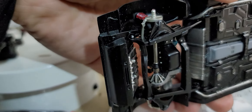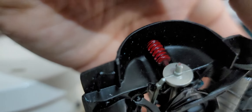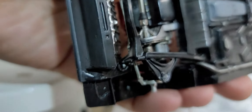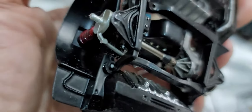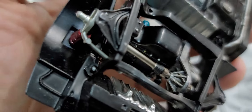When you're lining everything up and trying to install the subframe, you're going to need to move the peg that goes into the strut tower — you can see it coming out here. You're going to need to line up the subframe and the strut tower at the same time. You'll need a little bit of adjustability, and that's where the slow-setting glue comes in, as it takes a long time to harden, giving you time to move everything around and get it all lined up.